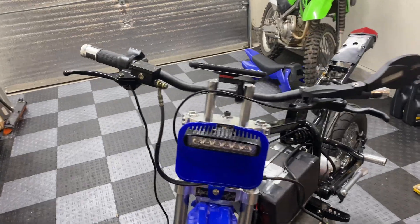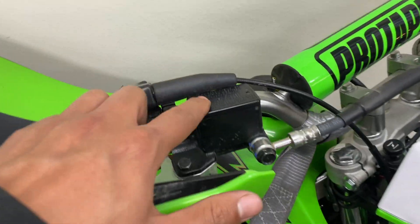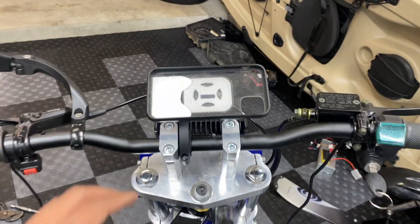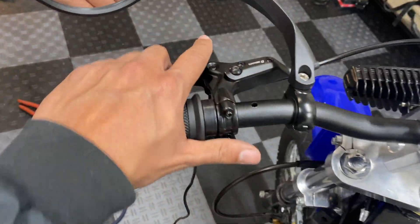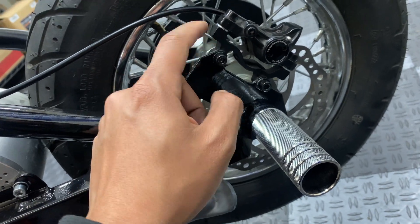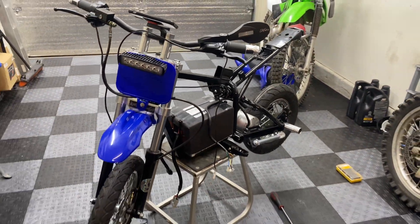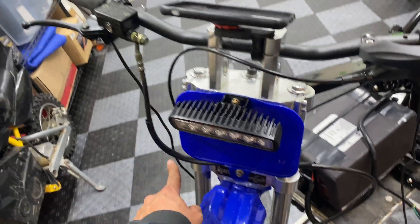Got the brake levers mounted. You'll notice that the front one has a brake master cylinder — that's because it's actually meant for a full-size dirt bike, kind of like the one on my Kawasaki. I ended up moving the phone mount to the center of the handlebar; I think it'll look a lot nicer there, almost like a cluster if I'm using a speedo app or GPS while riding. For the rear brake I'm using Zoom mountain bike brakes — it's the same style that Electro and Co and Lone Star use for their brake kits. I have a 160mm rotor paired with a 160mm adapter. If you're interested in checking out any of the parts I'm using for this project, I'll have everything linked in the description.